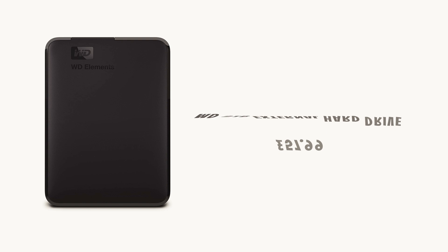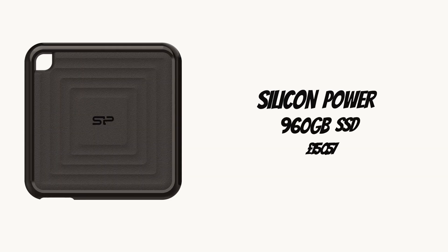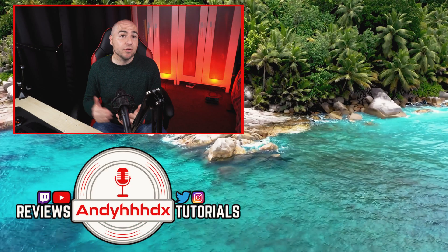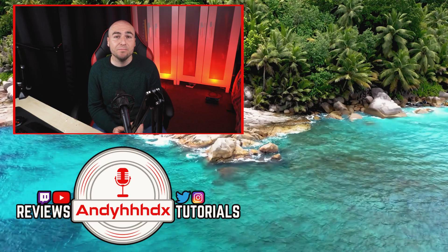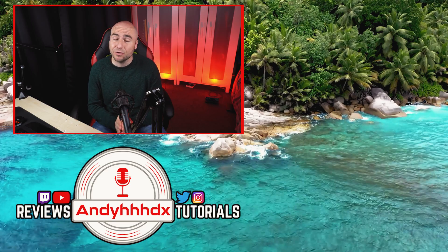So it's going to be a toss-up: do you go with a mechanical hard drive where you get more storage and it's going to be cheaper in price but you've got more chance of damaging that drive, or do you move over to SSD drives which have much faster speeds? They will cost you more money, but there are no moving parts in the drive, which means if you do knock them about, chances are you're going to be okay.